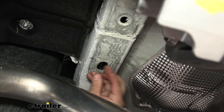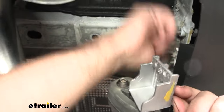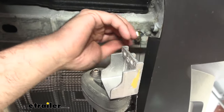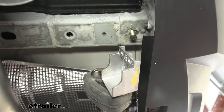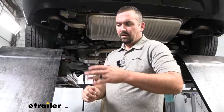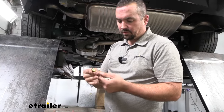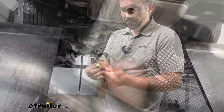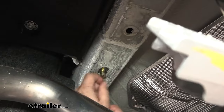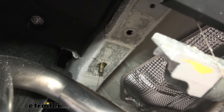It really doesn't matter as far as configuration — it doesn't have to be straight, because as I pull on the other end we'll get this to drop in. You may have to jostle it around a little bit, but you should see that drop through the spacer block. Leave your fishwire attached — this is going to help when we get the hitch up in place so that doesn't pop back up in the frame. Now using a reverse fishwire technique on the access hole, we'll prep and feed this in, then pull it down to give us our mounting point. We're going to repeat the same exact process on the other side.